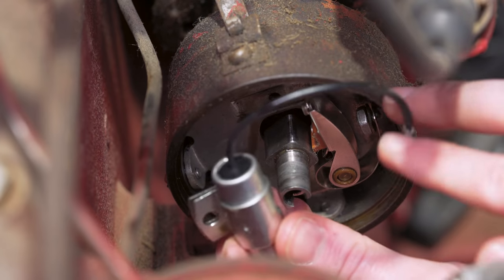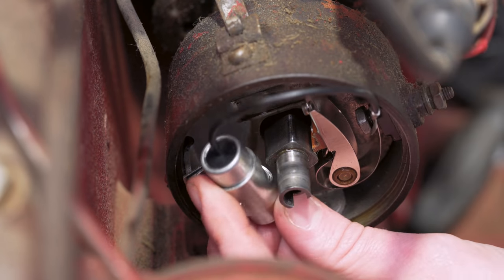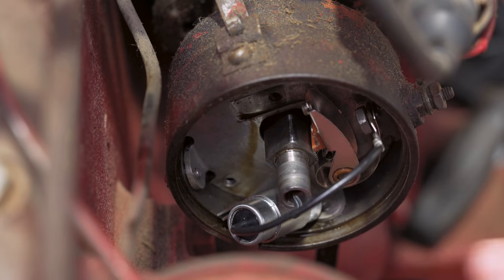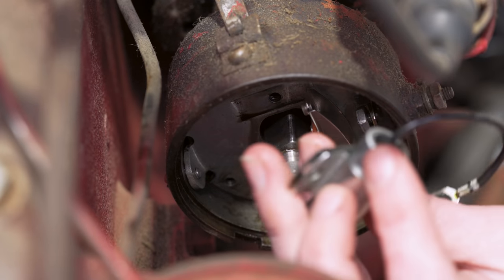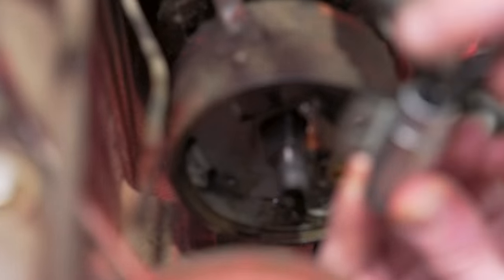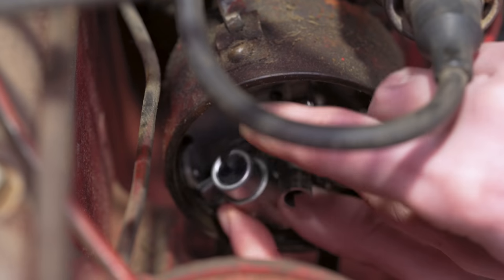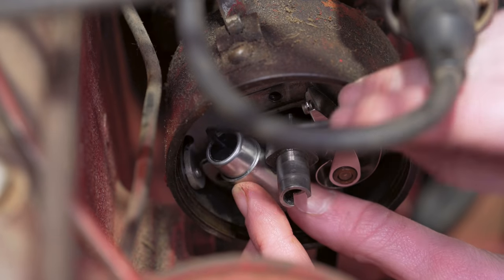Next you have the condenser. This wire wraps around and the wire is going to go on to the tab there, and then I like to use a magnet like this to get that screw started. Sometimes when you get your new condenser the strap will be on there and you might have to kind of crimp the strap together — sometimes it'll be a little bit pulled apart and you'll just have to crimp that till it's flat and then you're ready to install it right into your distributor.